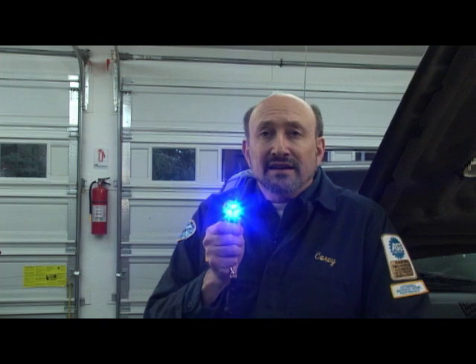Another one of my favorite tools is the RLD2. It looks like a standard flashlight — when configured, it comes on pretty bright. But it's unique: it's also for leak detection. We've all used dye fluid before — you add it to the oil or to the water, then fluoresce the fluid, excite it, and look for where the leak's coming from. Now with the RLD2, it's so bright that it's going to find the leak for you very fast and very efficiently. All you do is add the fluid and then fluoresce it.